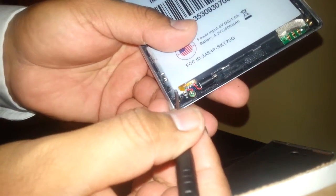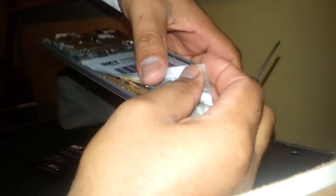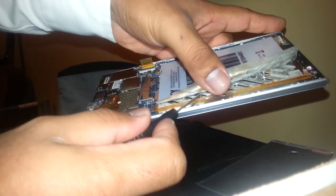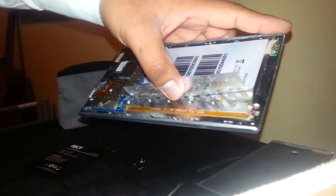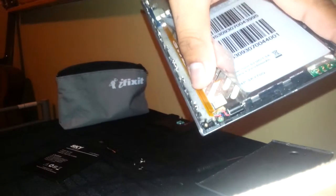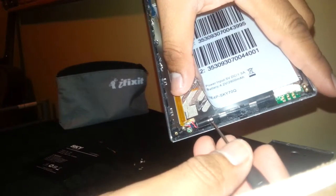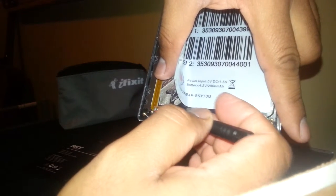Make sure to lift just the little end — don't touch this cable or you may damage it and potentially lose use of your phone. Just lift that one very carefully, and don't pull too hard on this cable. This is a very delicate flex cable, and there is something like glue under it, so we need to lift this vibrator carefully.